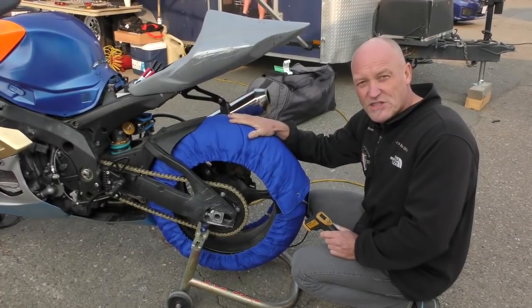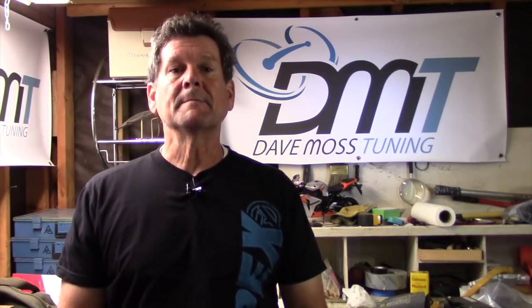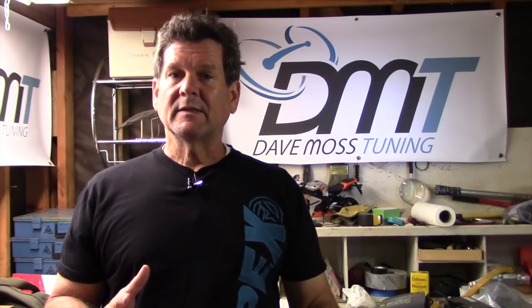One of the reasons Dave mentioned the power cord issue is because in that 15-minute segment, what we did was unplug those suspension heaters that were on the forks and the shock. When we unplugged those right before that 15-minute session, we think that's what really ramped up that extra 30 degrees of temperature in 15 minutes. Most often that's caused by too thin a power cord from your power source to the warmer. Anything that might be robbing power from giving the full juice to your tire warmers might cause some performance variance in how they heat up.